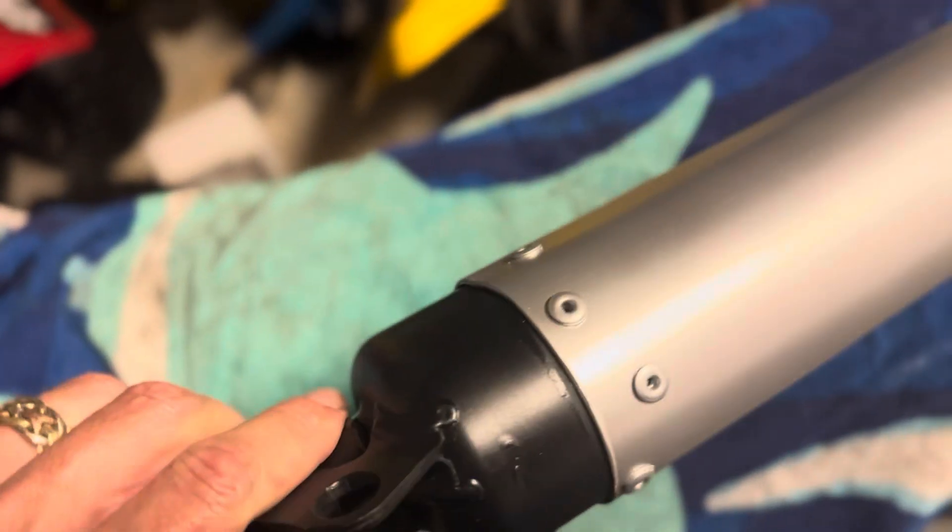The next thing we did — we got the exhaust pipe pretty much done. This is a very nice high-heat coating on this pipe using aluminum paint. I had to repaint it because we had some very deep scratches and I couldn't get the shine finish the way I wanted with the Prime MX wheels — it would've looked like chrome polishing rather than a nice alloy OEM finish. So I used a high-quality paint and I'm going to put a clear coat with hardener in a nice satin over it. The tailpipe also looks really good.